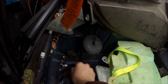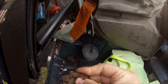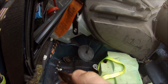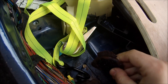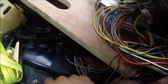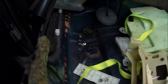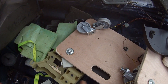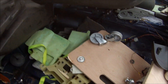There are these grommet holes that they always do from the factory - they just seem to be such a massive water trap. I don't know if it's from where the panels get pressed, but I've noticed on a few other cars that these little grommets, water just gets in the gap there. It's just a rubber grommet - water gets in and corrodes. I don't know whether eventually that'll get cut out and the hole deleted completely, because there's no need for it really, it isn't a drain. That one there is quite badly gone, taking all the factory paint and underseal off with it. I think they'll all get removed and plated in there - or I've got the other shell in the shed, so I can cut panels out of there and re-plate them in. If not, I'll just plate them over, get it seam sealed up.